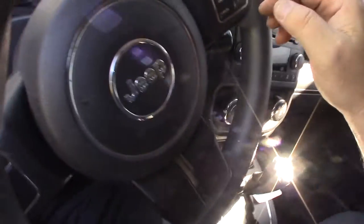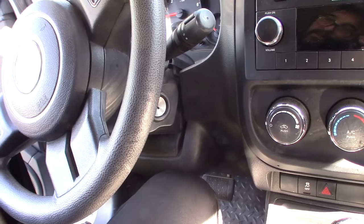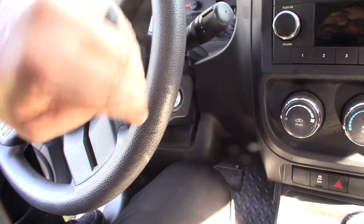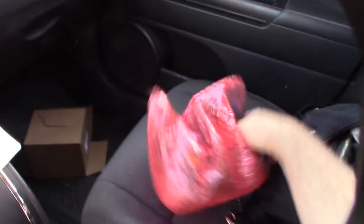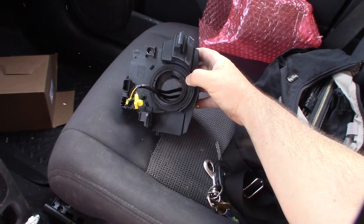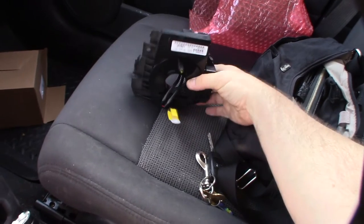If you're not familiar with the clock spring, it's what creates contacts between all your little devices and buttons and sends it back to the ECU — the computer. The issue is that because you need to be able to turn your steering wheel, you can't actually have wires that just twist around. So you have a series of contacts that go around in a circle — that's why it's called a clock spring.